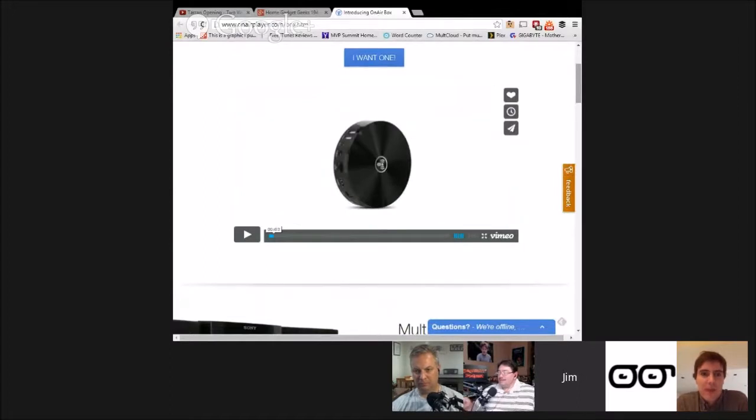But yeah, so all the main ones like MP3, FLAC, Apple codecs are supported depending on where you stream it. So if you stream it, for instance, to your MacBook, which we have an app for as well, then all the Apple codecs are obviously supported because we use a local Mac to actually play it back. If you play it on your Windows computer, you can use Windows Media Audio. So it always depends on where you stream it to. For the box itself, the box is based on Android, so we support the standard ones, meaning MP3, FLAC, and I think OGG Vorbis should be supported too.